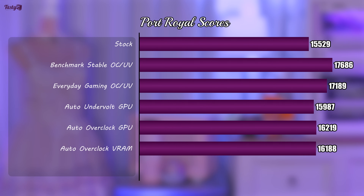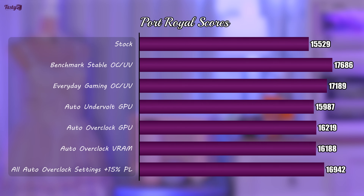I think something that I would do if I was looking for a shortcut to find some custom settings with a fairly decent chance of running on my AMD card is to make a note of all of these automatic results, and then combine them into a single configuration with the power limit raised. So I tested just that, and it gave me a result of 16,942. This lazy method gets you most of the way there and takes no time at all to configure — it seems to be a very valid shortcut.